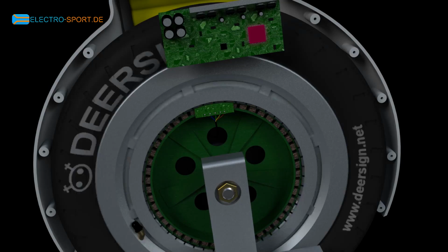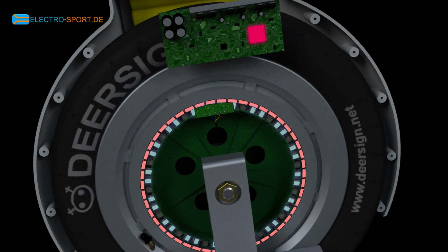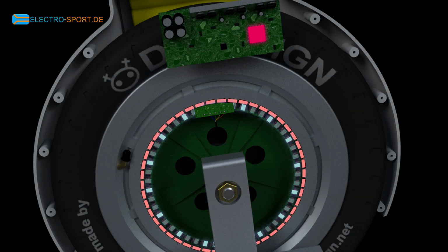But how do these components interact in detail? The CPU continuously receives inputs from the gyroscope on axis orientation and acceleration. If the driver leans forward, the angle of the wheel tilts forward. In response, the CPU instructs the transistors to give more energy to the motor. The transistors are pairs of three, with each transistor being paired with every third coil in the motor, pulsing the current at shifted phases through the copper coils, creating repulsion from the fixed neodymium magnets. As the magnets inside of the rim can pivot around the coil, the motor will start to spin.